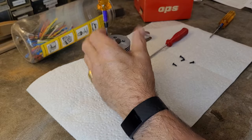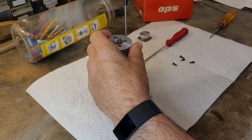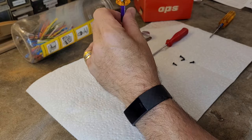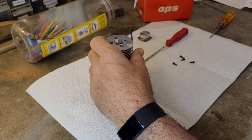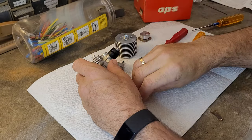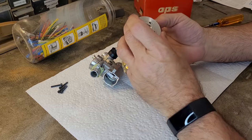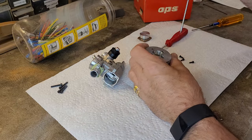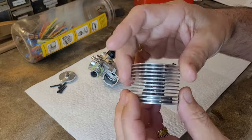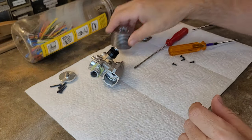It is a standard plug engine — it is not a turbo engine. Apparently there were a whole line. This is number 8841. There were multiple engines in this line, and the higher-end ones did have turbo plugs, and I believe they had larger crankshafts. I believe this one's a 12 millimeter. Now this is a separate head button. There's our cooling head — very nice. No shine cuts; it's one kind of uniform billet piece.